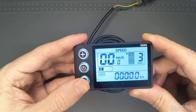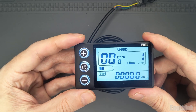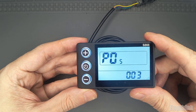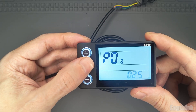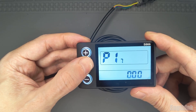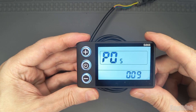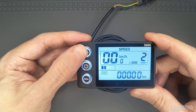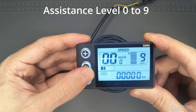Currently with three levels, the pedaling assistance will have stronger power steps. If you prefer finer control you can increase it to nine levels. To do this, enter the parameter menu again by pressing and holding the plus and minus buttons. Navigate using the power button until you reach P05, then select the number nine with the plus or minus buttons. Wait a moment until the system saves automatically and return to the main screen. Now you'll be able to select between nine assistance levels, giving you a much finer and smoother control of your motor power.